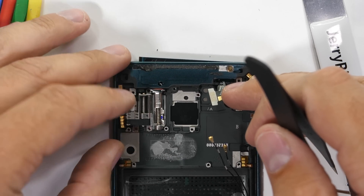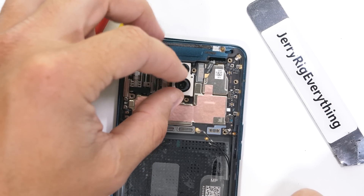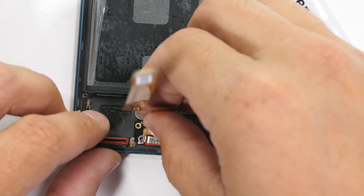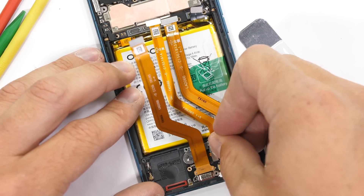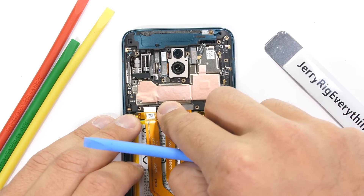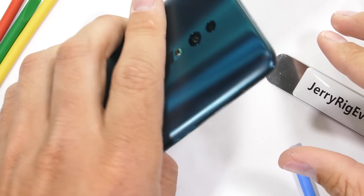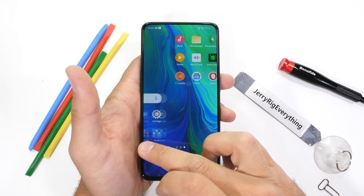I'll get the motor back into place inside its plastic guiding shaft and screw it into the phone. Then I can add the motherboard, the rear facing cameras, and make sure the Lego style connectors are all clipped in tight. I can grab the bottom circuit board and put that in place, clipping in the under-screen fingerprint scanner and the long charging port ribbon. Once the battery's back in its slot, I can add the last few extension ribbons and start screwing in those 22 Phillips head screws that hold everything together. Overall, I'm impressed with Oppo — this Reno phone is built much stronger than the previous Oppo Find X. And amazingly, even after being durability tested and taken entirely apart and reassembled, the whole thing still works.